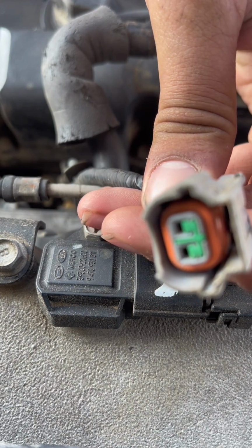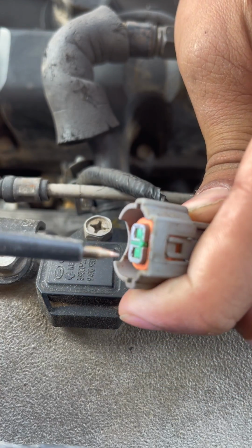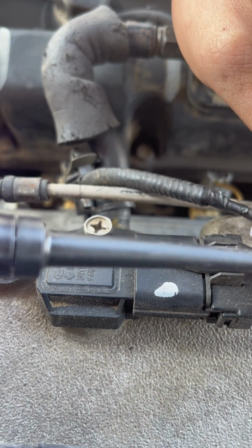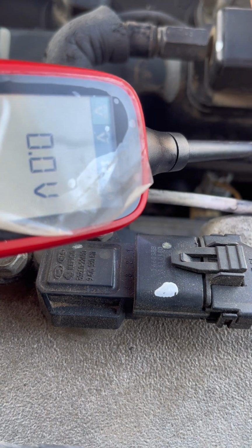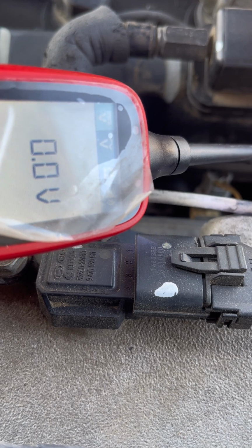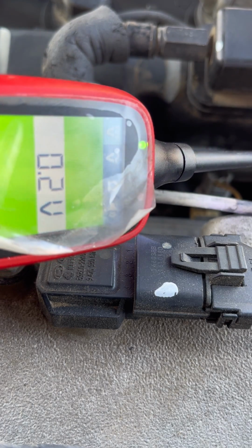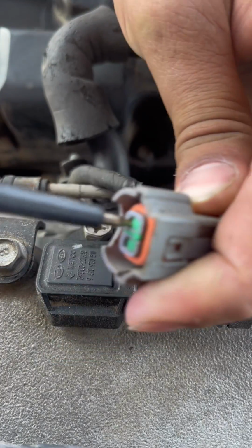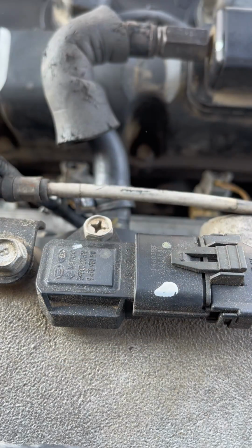Now let me show you the injector. With current coming on one line for power and one line for ground for pulse. You see this line. Switch on ECM. Switch on. Is good. Okay, and another line. No power coming. You see when I open the switch and here ground coming.